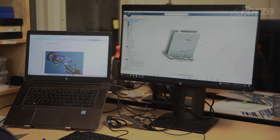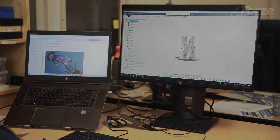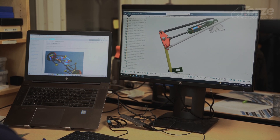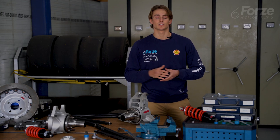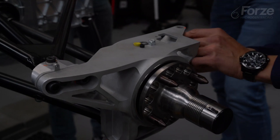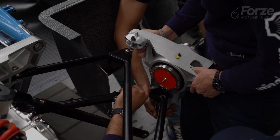Because our car is unlike any other we completely design and customize the suspension ourselves. Right now we are busy designing the third element and the anti-roll bar. With the design finalized, the components are sent out for machining at various partners like Klift, Westend and PMF. Once they have arrived back at our workshop we check all dimensions and see if they are ready for assembly on the car.